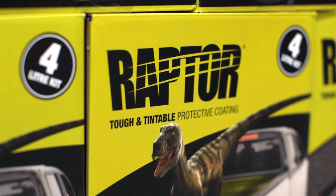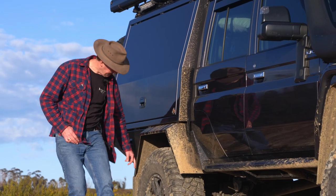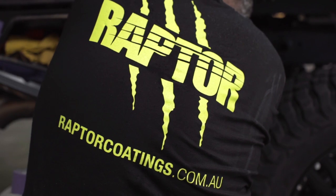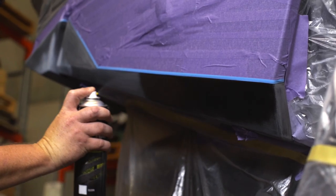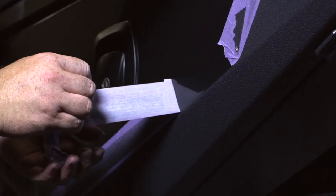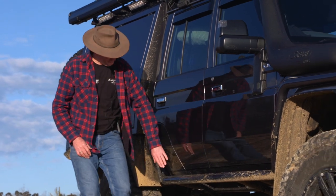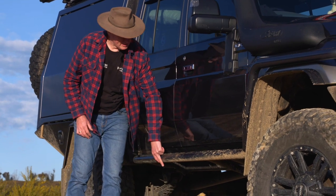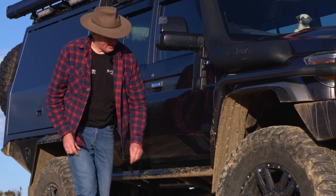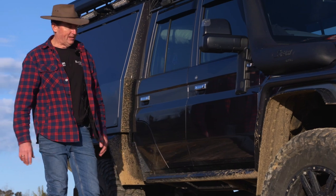While we're on protective coatings, we have a Raptor coating applied to the top of the sidesteps, the leading edges, and right along the edge here — all the areas that get smashed with debris from the front tyres are protected by Raptor coat. It was a simple solution — we painted it on and used the air compressor, the dual compressor, which was quite fun. It's worked extremely well, and every now and then I'll touch it up with some satin black paint. We've also applied a thick film along the leading edge of the side rail — the idea being that when people step and slide off, they're not scratching the paint. That's been a godsend.